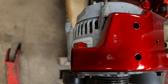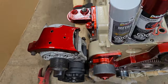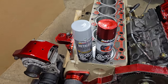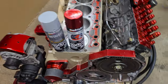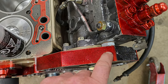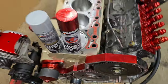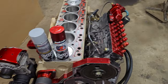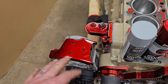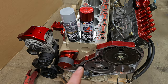This is kind of the finish that comes off of it — it's not bad. Now, I've learned doing this that prep is king. With any paint job, prep is king, but especially with this stuff. You can see here I had a little bit of paint over top of the aluminum and this product really highlights that. So if you want to do a really nice job, you need to strip this stuff down — you almost have to sandblast it or have it acid dipped completely clean.